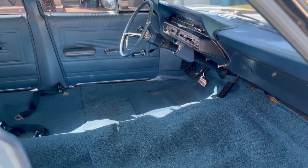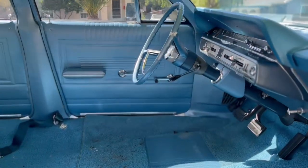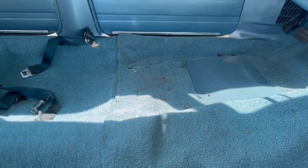All right, we got all of the seats out. The front seat bolts out from underneath the vehicle. There's one, two, three, four — there's eight bolts per seat on either side that you can access from the bottom of the car through little port holes.